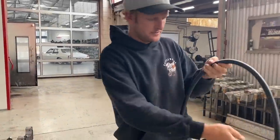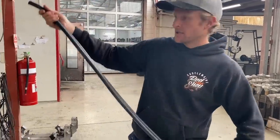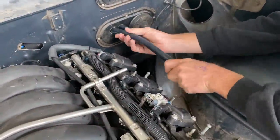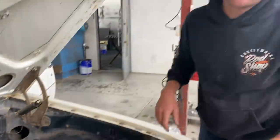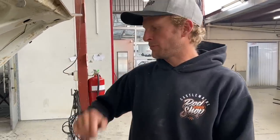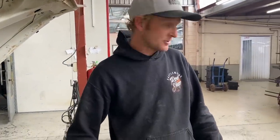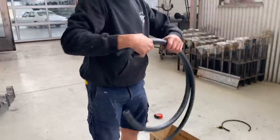We've got our new coil. Let's lay that out and grab both ends. What I want to do is feed them both in, slide under the dash, connect them both back up, then work out in the engine bay exactly where they're going to run. Feed both ends through. To save getting in and out, I'll grab a couple of hose clamps, jump in, slide underneath, and hook them both up. I'll put the hose clamps on and run them through underneath the dash to the heater core.